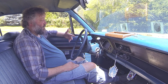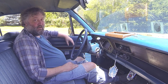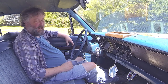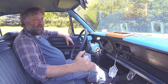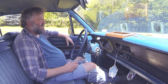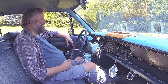What worries me about that a little bit is sometimes you can actually start it and drive if the neutral safety switch orientation isn't proper. I had that on the truck one time — there was no neutral safety switch and it had a B&M ratchet shifter with a golf ball style ratchet. Yeah, it was totally in gear when I started it. And then when I was revving up, I heard it and there were the rear tires spinning in the grass, burning the grass — you could see the smoke. It's like, oh Jesus.